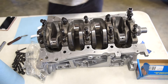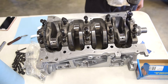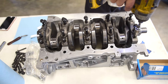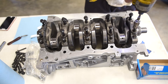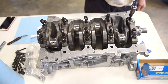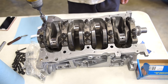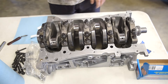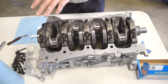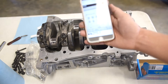I'm simply going to grab my quarter-inch impact and lightly run these in just to where they touch with no torque at all. Now it's time to torque all the bolts — there's a specific order you tighten them in. I'll display the torque sequence here so screenshot that if you need to.